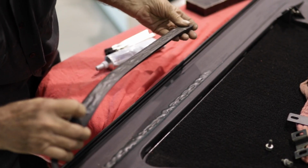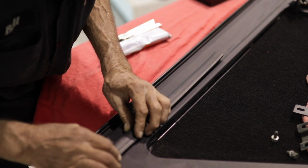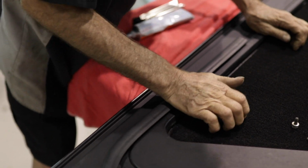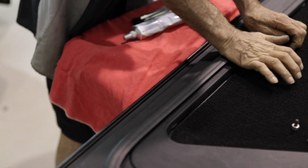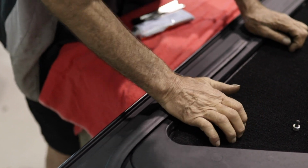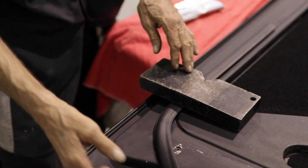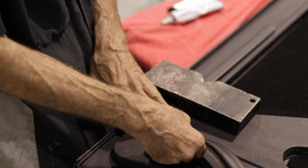Once the adhesive is set up, you can lay down the seal again with the high lip just resting on the raised edge of the inner hood. Using the palm of your hand, firmly push the seal into place against the adhesive, applying a light circular pressure to ensure the two surfaces make maximum contact. Apply a fairly heavy weight as shown to prevent the seal you just put down from moving as you make the seal contour to match the corner.